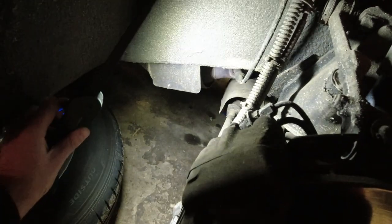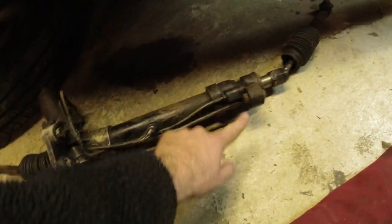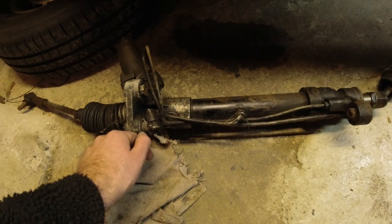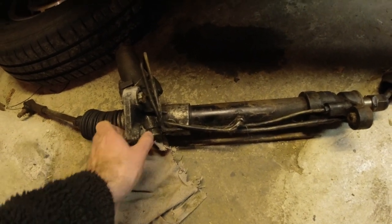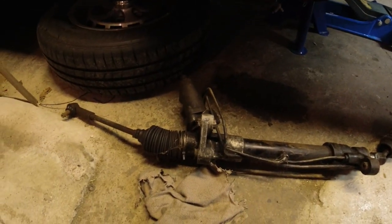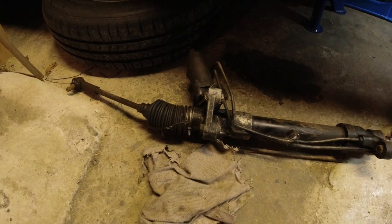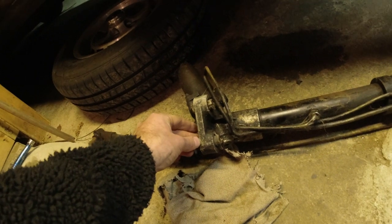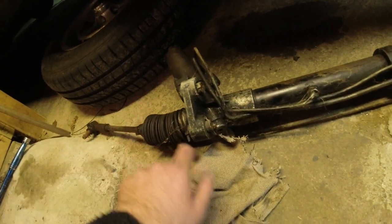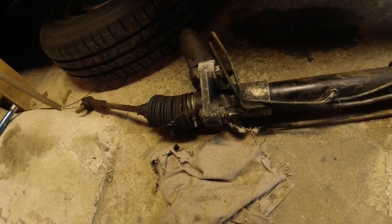However, there is one more thing, because I like to count the steering as part of the front suspension. You have three bushes on a steering rack and they usually go bad. I have a spare rack over there, so let's have a look at it. Here are the three mounting points — little rubber bushes. What happens when the rubber no longer is in contact with the outer and inner parts is the whole rack can move back and forth when you steer. You'll move the steering wheel and the wheels won't turn — just the rack going back and forth. Very odd, very weird feeling, feels absolutely awful. But quite simple to fix: just remove the rack, hit out the centers, push away the rubber, make a little cut into the bush and tap them out. The new ones you simply push in and they're a lot, lot better.